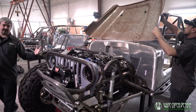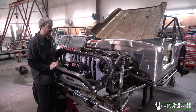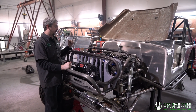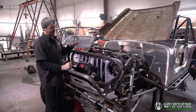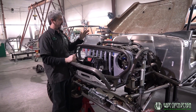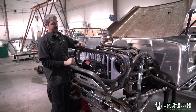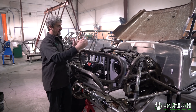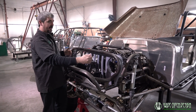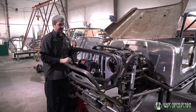Right now we're building this thing as a good built roller. This one's hot — it's got a coyote motor in it. This is the new Ford hotness. We had to stretch the front frame rails out a little bit because this thing is a dual overhead cam — it's just pretty wide, but it all fit and worked out. A lot of people ask us about this grill protection hoop. We can't really weld it to the frame because everybody uses a little bit different hood and grill setup. What we can do is bend this thing and tack it in place or ship it to you — that way you final-fit it around your body after you get your tub on, square it up, then the hood goes on, then the grill goes on, then you put this on, square it up, and weld it.